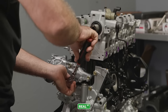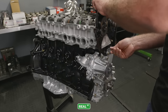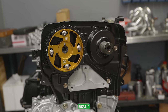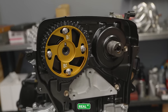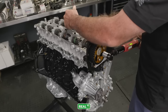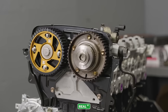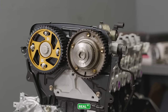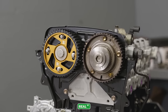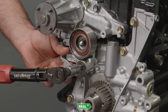For those of you that haven't experienced VVTI on a 2JZ, it's a really helpful tool when it comes to balancing power and traction. Because the engine is going to spool the turbocharger sooner, I'll be able to mitigate the boost level and avoid a big boost spike that's going to knock the tires loose. So it works in your favor when it comes to average horsepower — you're going to have a car that accelerates harder out of a turn, spools the turbo easier, with really no ill effect. And because it's all OEM-engineered Toyota parts, there's not really any risk involved.